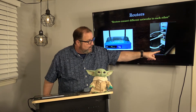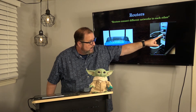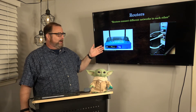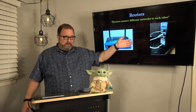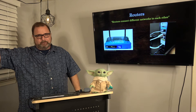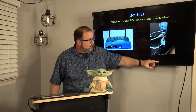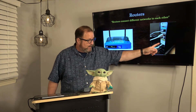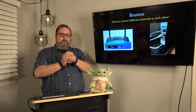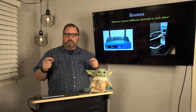If you look at the back of a typical cable modem, you'll see the cable coming in — and look at that, there's a switch. So they're hybrids. In the back of my modem is a switch. They call them cable modems, but basically that's a modem and also a switch. If you see a little quadrant of ports, that's the switch function. Whether it's fiber — like AT&T — or coax coming in, that is connecting to the router function of the device. So switches build networks and routers connect networks to each other.